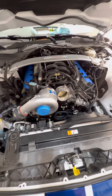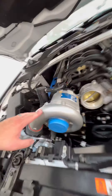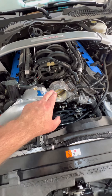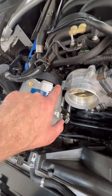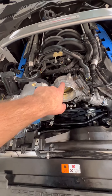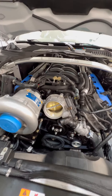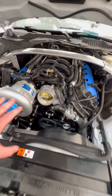So that's essentially how it works, and right now we've got the supercharger mounted all set. We've got the throttle body on and throttle body spacer. One of the interesting things with this is you have to put the spacer on, otherwise you're going to rub on the belt for the supercharger. You actually have to put the throttle body on 180 degrees sideways, which I thought was kind of odd — it's almost upside down. But it's the only way for it to work and fit in here.